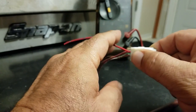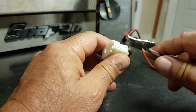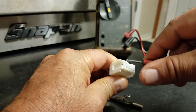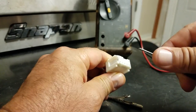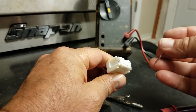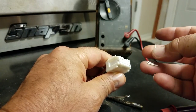Let's say we need to see if this car has power on the red wire. We would usually want to take our voltmeter, maybe pull the alligator clip lead off, and try to fit it in there. But a lot of these cars today, the pins are so small that a probe can't get in there to check power. So what I usually use is what they call a T-pin. A T-pin is something you can get at Staples — they sell a box of them, they're stupidly cheap.